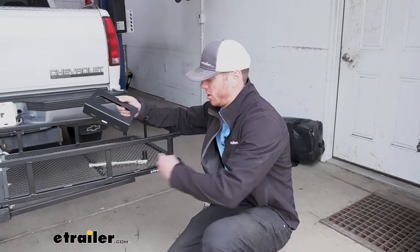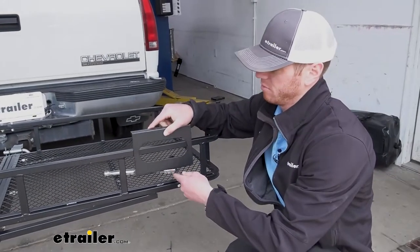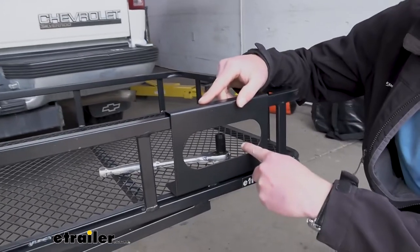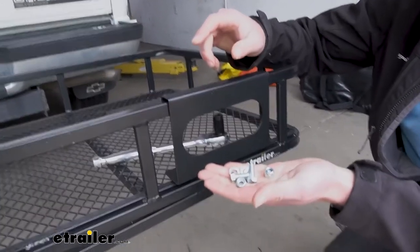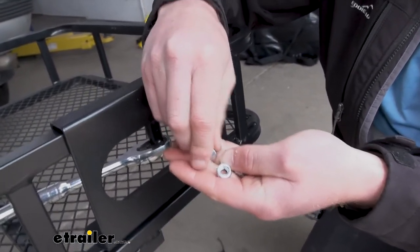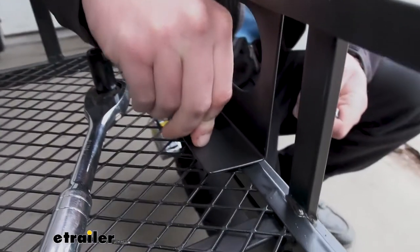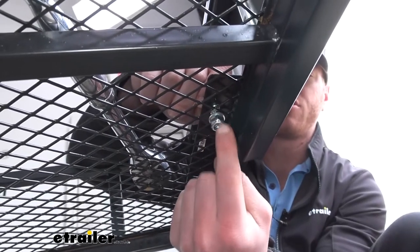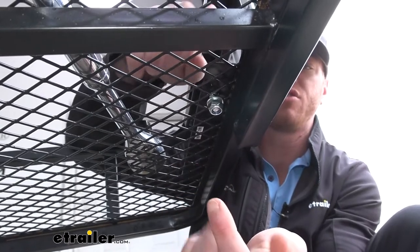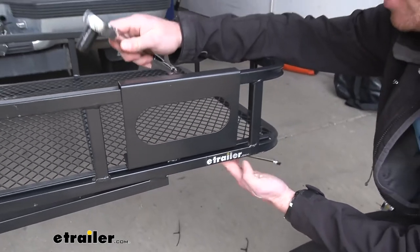To get the bracket installed, I want to install it on the farthest most point right here. All we've got to do is just put it like this, drop it down, and it sits into place. I like to even it out, so get a tape measure and just eye it out. We're going to have some hardware with the kit — we're going to go with the bolt with a washer on it and put it down through this hole. On the other side, we're going to take another washer and our nylon lock nut. Get these just hand tight for now and install the other two, then center it up and take a half-inch wrench and socket to tighten it all the way.